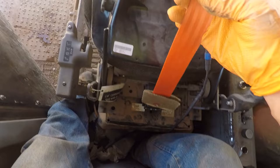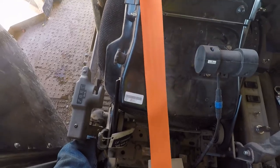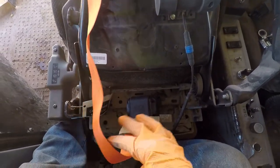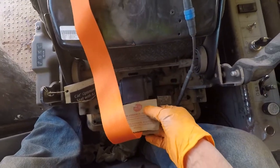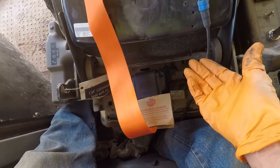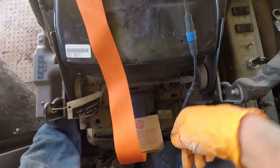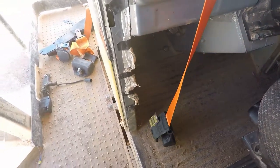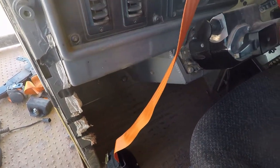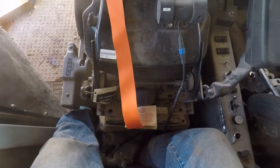Going back together with it — the main thing is you obviously don't want to have any twists in this. So we got all the twists out of this one. We're going to cinch this all the way down. You pull these cardboards off last — that's what's going to make it all retract in. If you pull that off early, you just end up fighting it, because as it retracts in it ratchets in, so you can't pull it out until you retract it all the way. Best to just leave those on and pull them off at the end. Same on this one — you don't want any twists in that when you go to reinstall everything. Let's continue getting it all buttoned up. We'll put the dates on the seat belt with the stickers — they're good for 3 years after the install date.